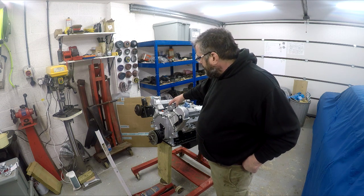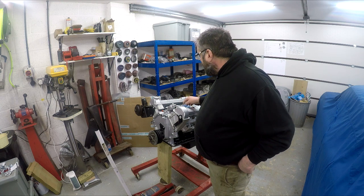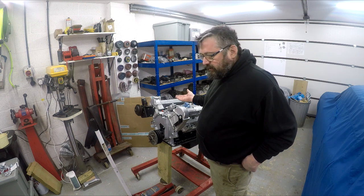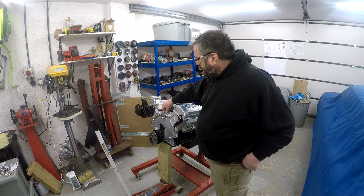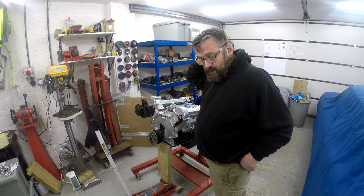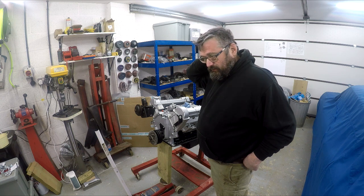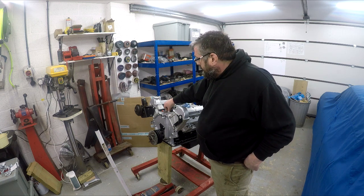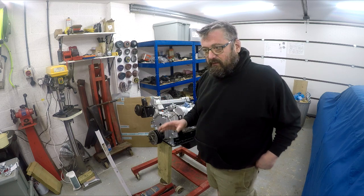I've just put on the thermostat housing with the thermostat fitted, and I've also done the water pump — fitted that back in and shimmed it up with the correct gasket. I used 10 thou because when I put the cover on the water pump there was no gap. I checked with some plasticine and there was about a 7 or 8 thou gap between the top of the bolt and the inside of the cover without any gasket, so a 10 thou gasket gives me roughly 20 thou clearance, which is what you're looking for.